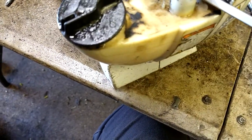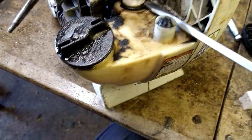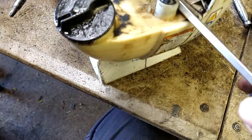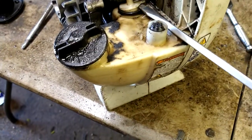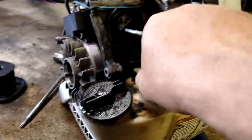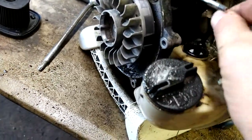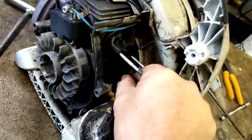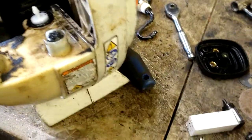Get up underneath it here with even steady pressure. It's easier with two hands — you need one hand to hold it down while you pry. It just pops right out. Pull this out. The fuel filter should fit right through this grommet. Pop the drain out — boom. Drain the tank and get all the old gas out of there; you don't want to run old gas through a new carb and fuel lines.